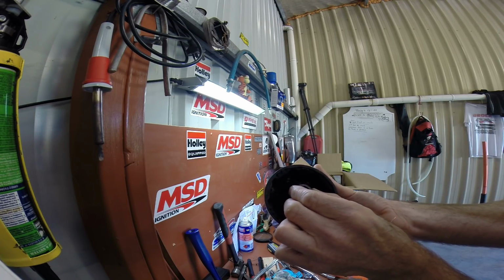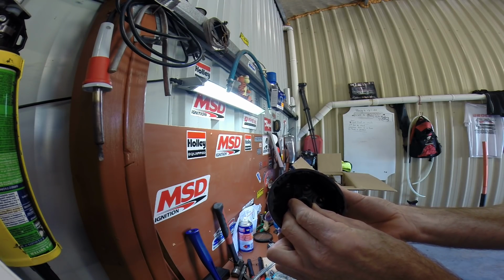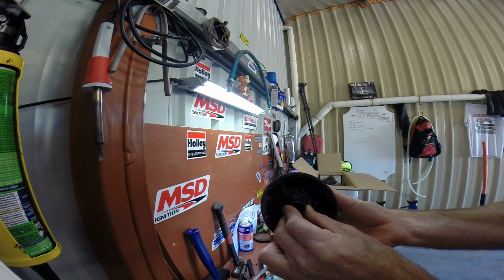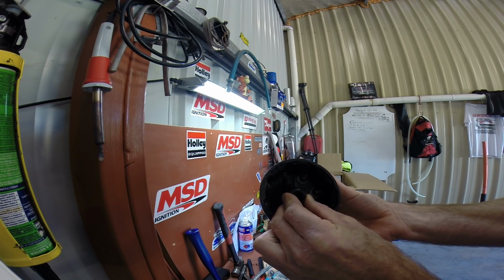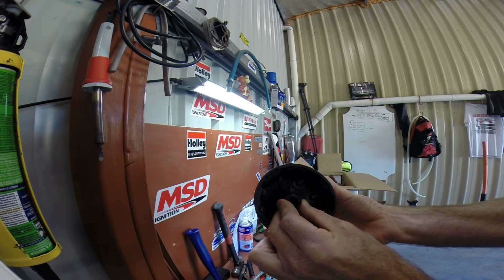If you had a spark jump to the next cylinder a lot earlier, guessing there, you're probably 20-30 degrees earlier advanced, that'd be shocking to the engine. So it's about there, and I'm quite happy with that. What's happened is, because I've locked it out at 30 degrees, it's twisted it around a bit further, if you understand what I mean. If I went back to standard trim, it'd probably be about there. But to me, it's still acceptable. I'm still quite happy with that.